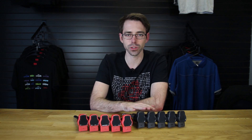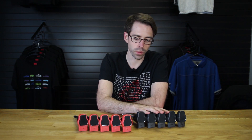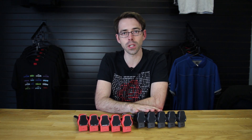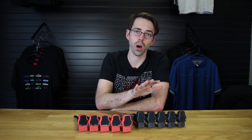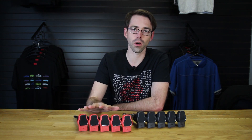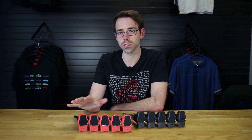Here we have the two options of ignition coils. Here is the original Volkswagen version. You do want to make sure these have been updated — they've been superseded a few times — so on our site you'll always find the latest and greatest version offered. Here we also have the Audi R8 version, which is commonly used on many VW engines but also fits the 2.5.